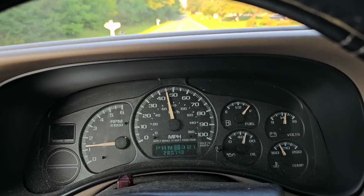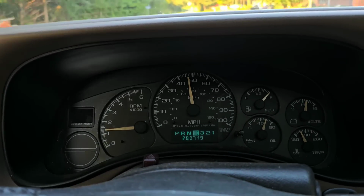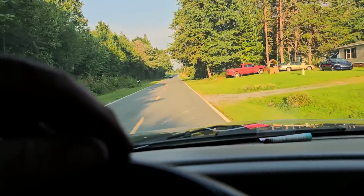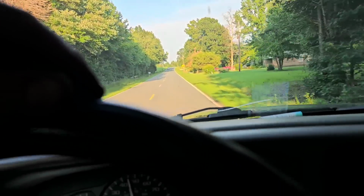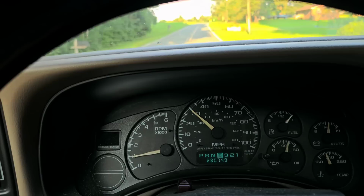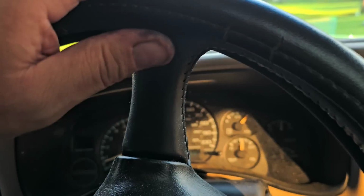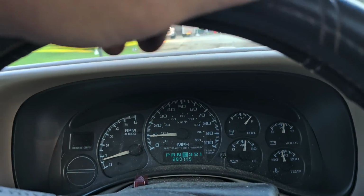So also there, I just wanted to show you that you can switch the wires. You can reverse them by mistake, and it's not going to affect anything on a 2-wire sensor. So, all right, let me get this thing turned around and get back to the house. I just wanted you to see that the light is still out as I'm going down the road here. On the house any moment. So yay, it's all fixed. Chris is going to be happy with this. So I am happy with this. All right, so that's good. I'm happy with that repair.